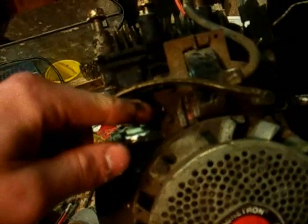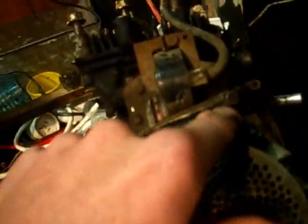Once you're sure the problem isn't outside the coil, check the gap between the flywheel and the coil posts. To gap it using a business card: undo these two bolts, turn the magnet so it faces the coil, stick a business card between the coil and the flywheel — the coil will be sucked toward the flywheel — then do up the bolts and remove the business card. Your flywheel is now gapped.